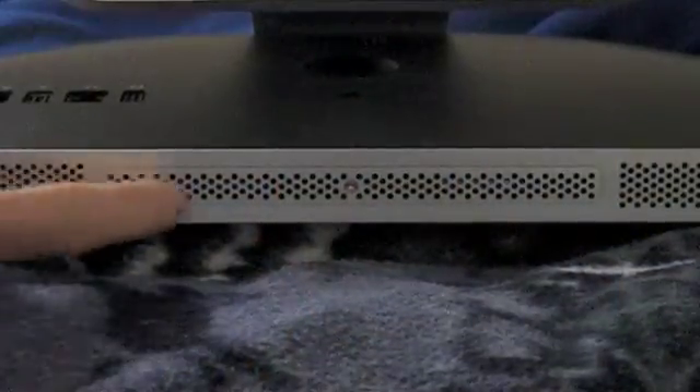The first thing you'll notice is this panel down on the bottom here, once you flip the iMac over. You'll want to go ahead and unscrew it with a very small tip Phillips head screwdriver. I only have a small flat head, but it looks like it's coming out just fine.